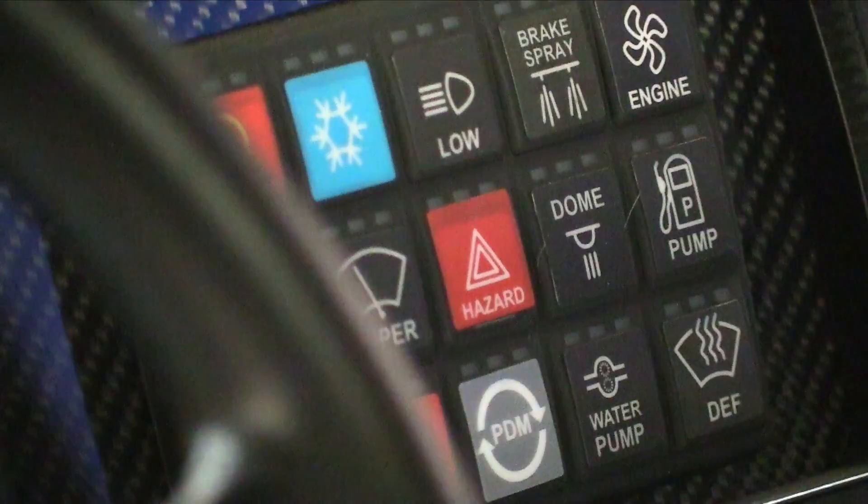I see you've also got that CAN keypad in there to control everything? Yeah, we wanted to make sure this car is as simple as possible. With the race-grade 15 keypad you're able to have multiple functions with the regulation of the status of each controlled device without having huge amounts of toggle switches and lights. For those who aren't familiar with that CAN keypad — it communicates the status of each button or switch via CAN. Instead of a traditional harness with wires for each switch, these CAN-based keypads only have four wires: 12 volts, ground, CAN high and low.